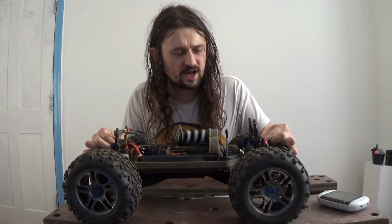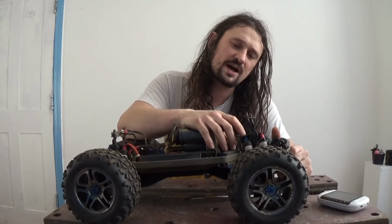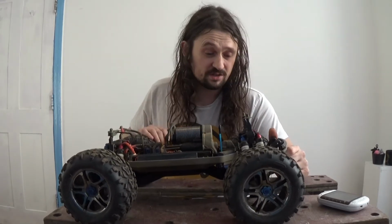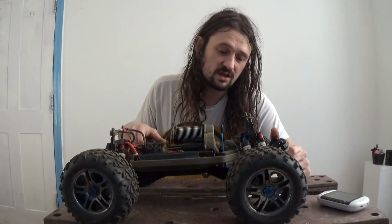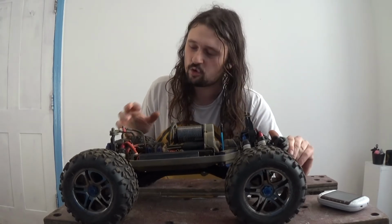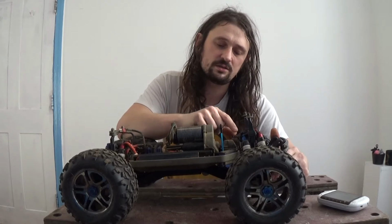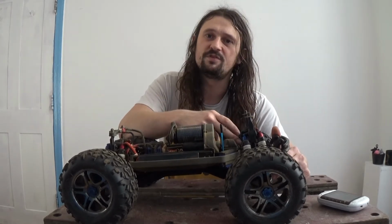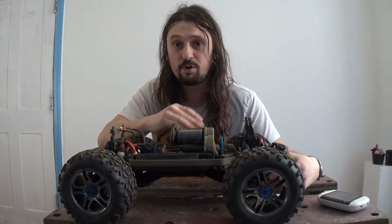I would put these coloured caps you've got here. These are the Traxxas Ultra Shocks, which I rate. I've had them on the Stampede before and various other things. They don't break. What they do is under extreme jumps or quite heavy jumps, the caps can pop off. Traxxas sell aluminium caps for these. The aluminium caps, in my experience, do not pop off.